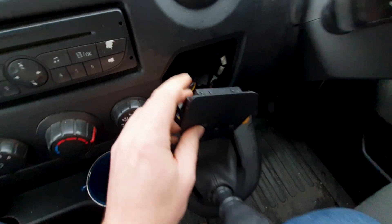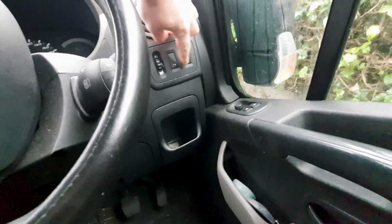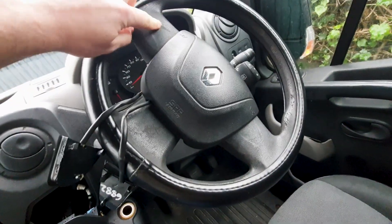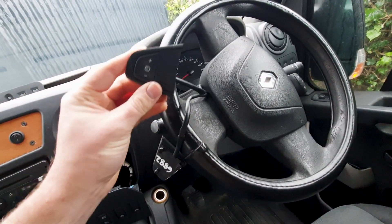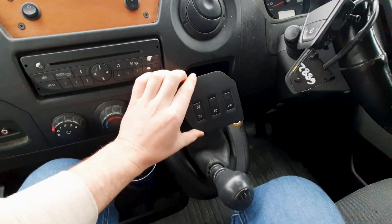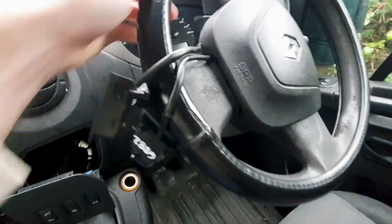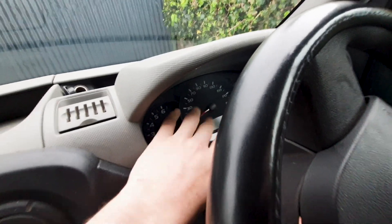There's also an eco mode button, I think it's just for lower fuel consumption, and they all color-matched nicely. Over here I found some more switches — these two don't actually work because I don't have any parking sensors. On Renault Masters you'll see buttons here and here on the steering wheel, and these are for the cruise control. I managed to find matching buttons, and under the airbag there are plug-in connectors, so theoretically once I had all these switches in, the van could potentially use cruise control. On the dash there should be indicator lights for cruise control, but my dash doesn't have them.